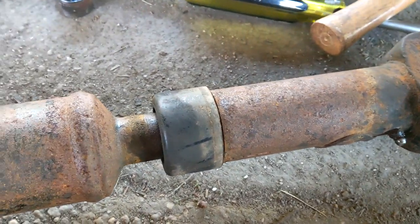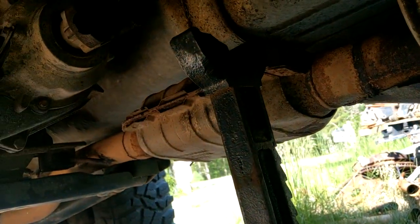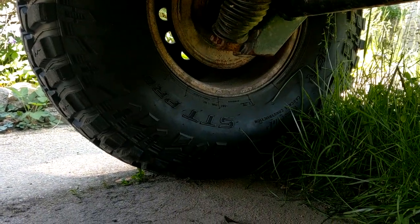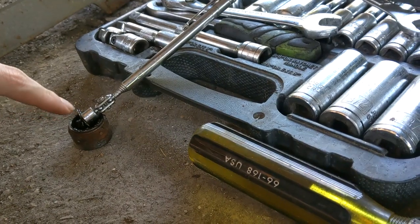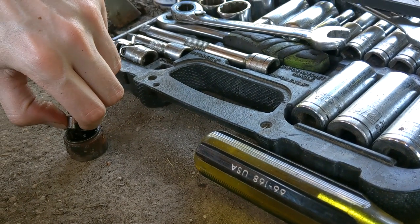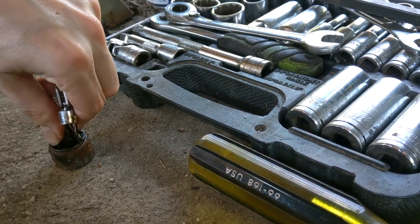The drive shaft was basically locked at the slip joint - both sides had to come off with prying and pulling. Make sure your parking brake is set and you're on flat ground, because once the drive shaft is out, there's nothing holding the vehicle. At the very least, block up the tires. The drive shaft is what stops the car through the transmission. Watch for U-joint caps falling - catch the needle bearings and keep dirt out. This is a good time to change any U-joints.